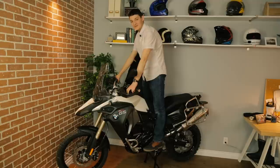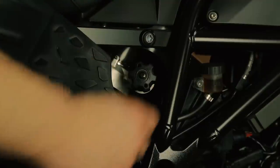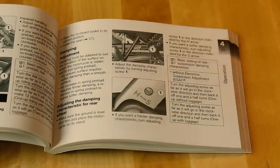On bumpy terrain, you'll want the rest of your digits keeping their grip on your grips. And finally, mod 10 of 10 is a suspension adjustment. Here's the preload knob on my rear shock. How I adjust this mainly depends on whether or not I'm carrying a tent and how many donuts I ate for breakfast — clockwise increases preload for fatter Ryan, counterclockwise decreases preload for skinnier Ryan. This is the damping screw, which is more directly relevant to off-roading. Bumpier surfaces like softer damping, while concrete surfaces prefer harder damping. However, damping needs to be tempered by the preload adjustment already made. If I've jacked up my preload to account for time spent at Timmy's, then I also need to err on the firmer side of damping. The same goes for riding style — I tend to spend a lot of time airborne, so I always set my compression damping a little bit higher or stiffer, just so my suspension doesn't bottom out. Obviously this subject is subjective to each ride, rider, and riding style, but those are the basic ideas for getting started. And that's how I mod my motorcycle for off-roading. Thanks for watching.